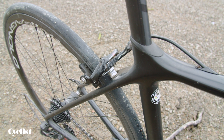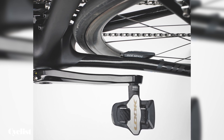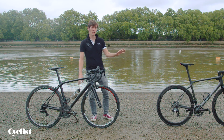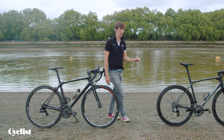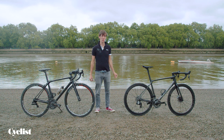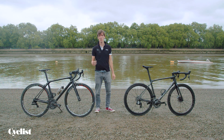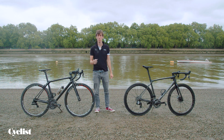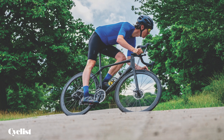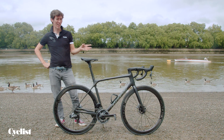Further back, the BB is slightly thinner on the older version, and we have a little less tyre clearance at the rear — everything's just a little bit tighter. Below the skin, something we can't see is that the new Giant TCR uses 150 more carbon swatches, which are small carbon pieces put together during the production process. This means you can program in the ride performance and stiffness in a much more specific way, and it cuts down weight while increasing rigidity — or at the very least, that's what Giant claims. So while the silhouette may be similar between these two bikes, we can see there's been a constant evolution across every single component.